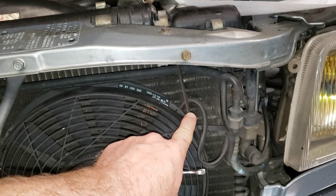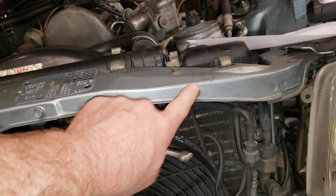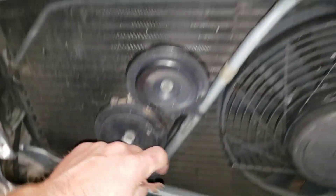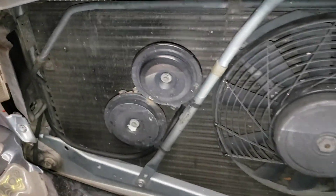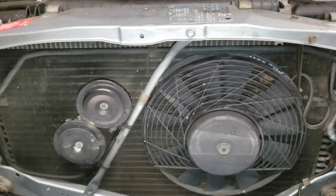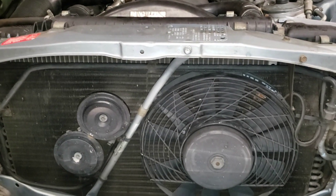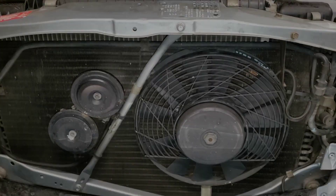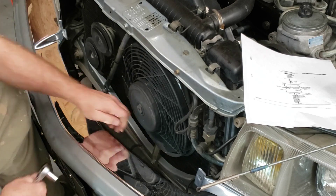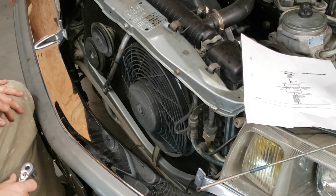We've got this short bracket here — you don't really want to put a wrench on that, it's too close to the radiator. We're going to get a 10-millimeter and get this guy off, and get this bracket here. There are two bolts here and here. I'm going to disconnect that — it holds the horns — and take this one off too. So we're going to take the horn, the bracket, and the fan all off together. While we're at it, we'll clean up the condenser a little bit, get some bugs out of there, then swap the fan and reinstall. Hopefully there are no nuts to contend with and everything will be self-tapping screws.